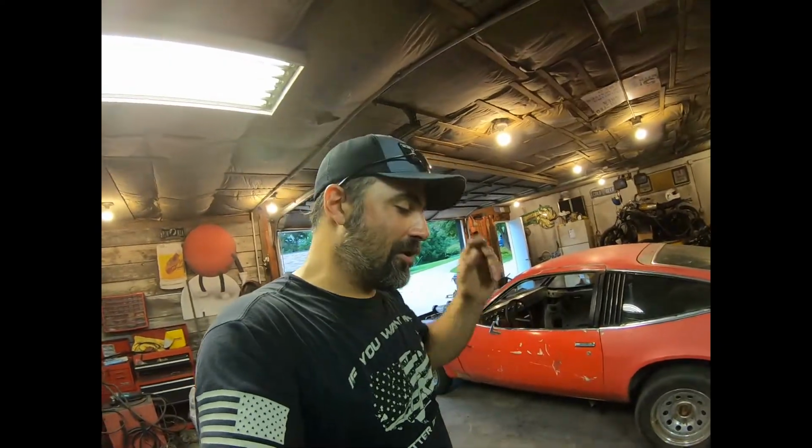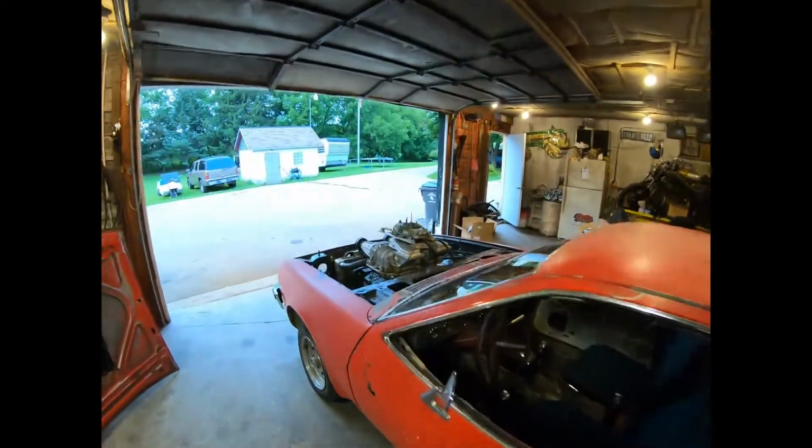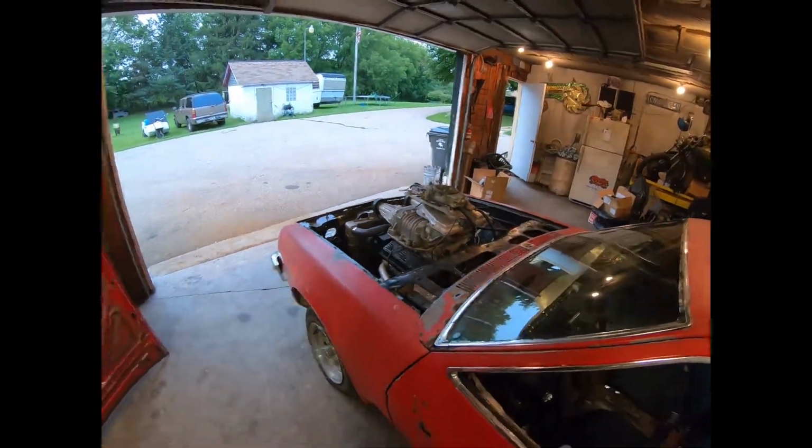So to finish that story off, I go out there, did the 3 or 4 donuts. It died. It backfired loudly through the pop plate in the intake, which I am really glad I put on there, because it's happened a couple times now, and it probably saved my intake, saved some welds, or didn't balloon my intake anyway, so that's a good thing.